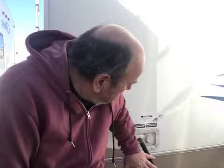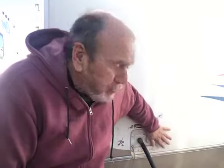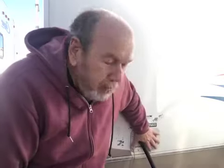Finally, this isn't actually a major one, but I do it anyways. This particular plate, which is your freshwater in plate, is nothing more than a little plastic piece that in my particular case sits underneath my refrigerator. And again, it's just a cold point where the outside cold air has very little insulation to the inside warmer air. So we'll cut a piece of bubble wrap and tape it to the outside of it. That should take care of the outside. We're going back inside.